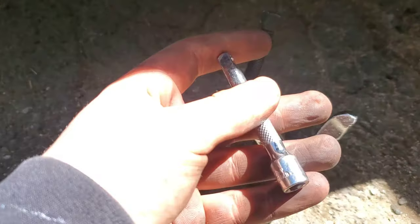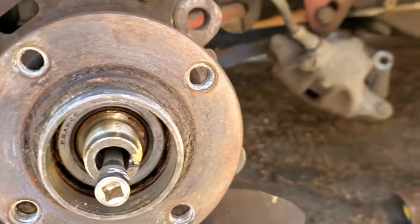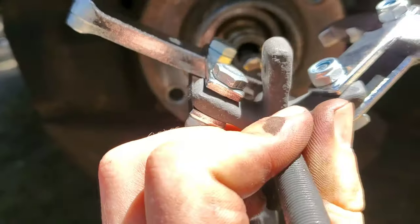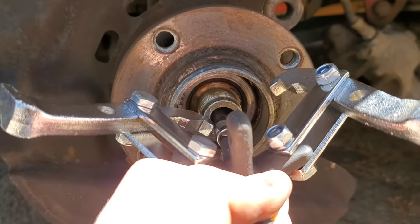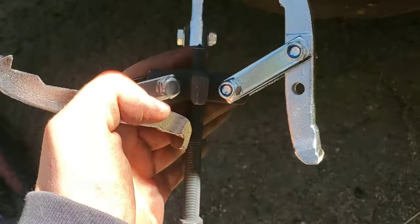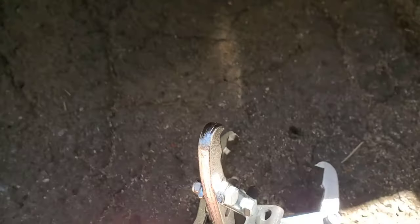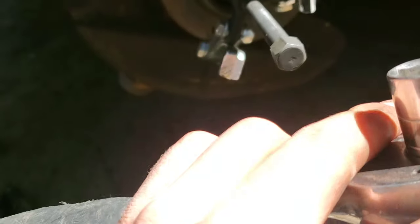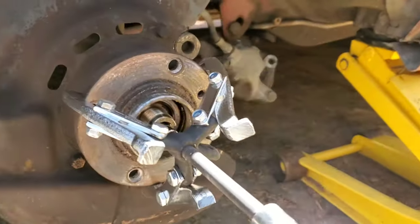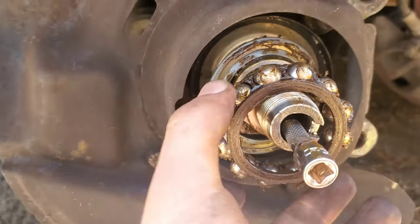Take your puller - this is a quarter-inch drive extension - put it on like that. Take our puller, line it up right in there, get it hooked on and start pulling. The reason I'm putting this extension in is there's not enough threads on this puller to actually pull the hub off - it was completely maxed out and it wasn't even pulling on it yet. You might have a bigger puller and this step is probably unnecessary. Pulled the hub off in about five seconds and it just completely disintegrated. So glad I'm replacing these - I've been driving around on these since I got the car.